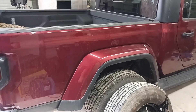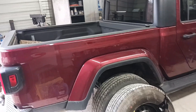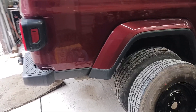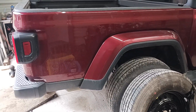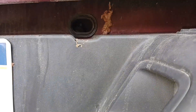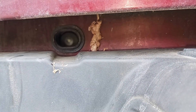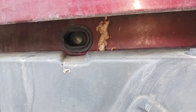For those of you that do not know, the spare tire in your Gladiator is stored underneath the bed. It has a crank system that lowers it. I'll show you how that works and how I want to lubricate that crank system. First thing you want to notice is back here underneath your tailgate — you have this hole with a rubber grommet in it. Back in there you can see where you put your jack handle to lower the spare on its crank assembly.